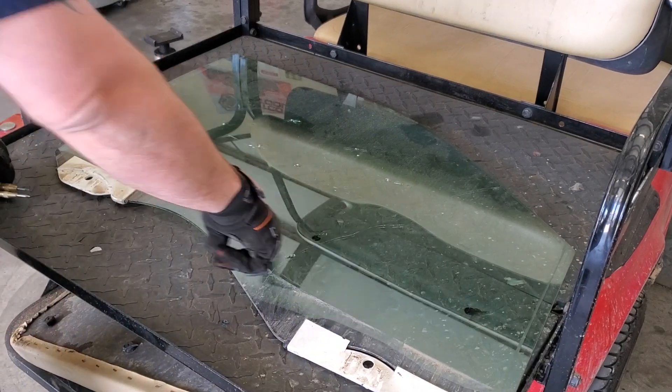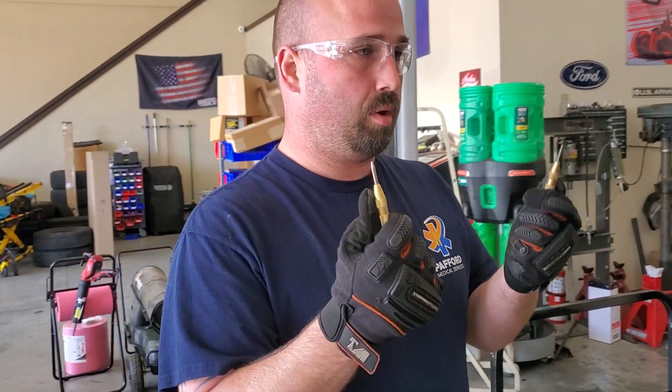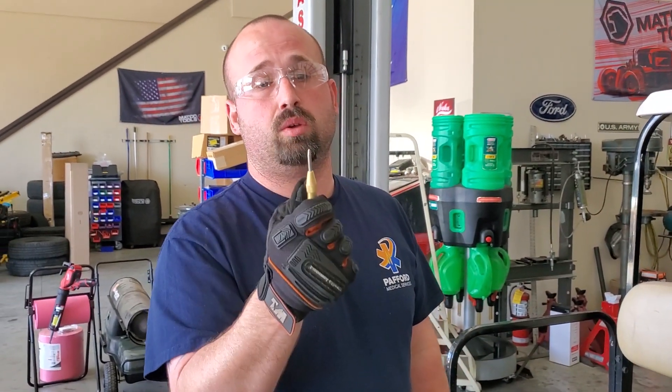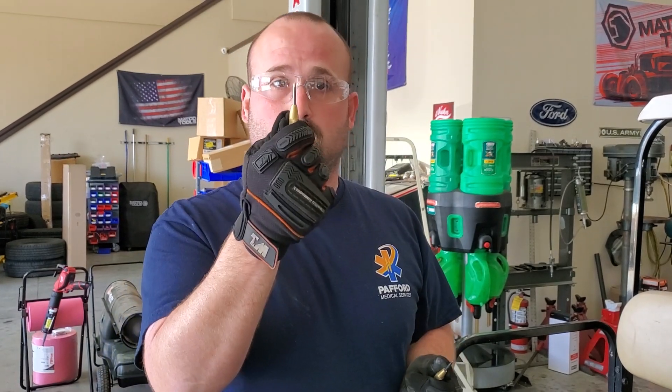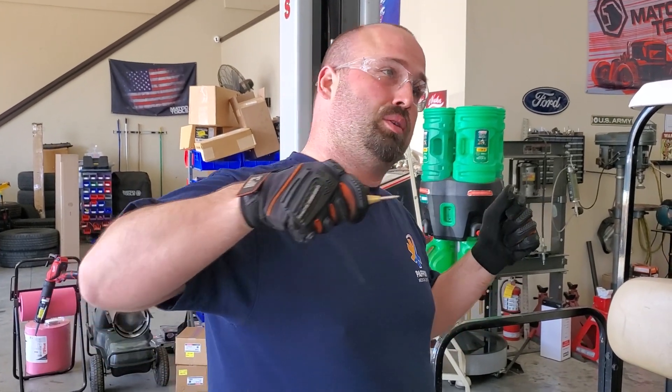So if you already see a crack in the glass and it's not shattered, do not waste your time with a hammer or one of these punches. And if you are going to use one of these or the hammer style, have your gloves on and safety glasses on — glass will go flying right into your eyeball. On tempered glass, you push, it breaks, and your hand goes right into a shower of glass. Those little pieces will cut you. So there's a little tip for you guys today.